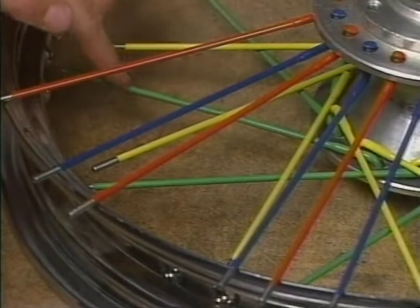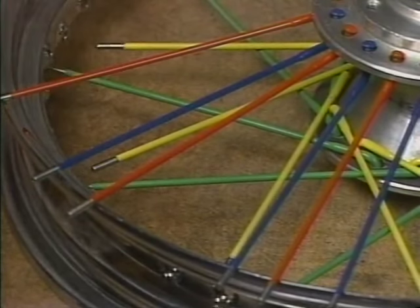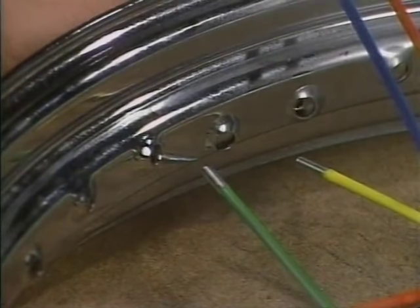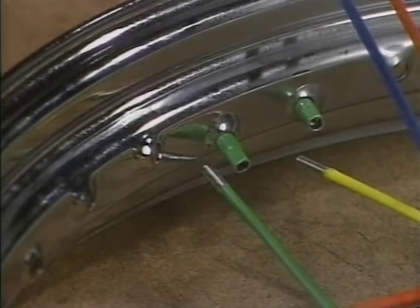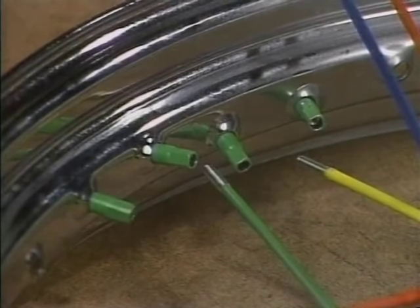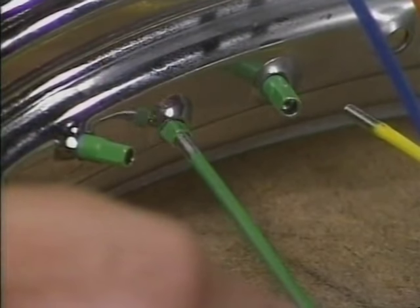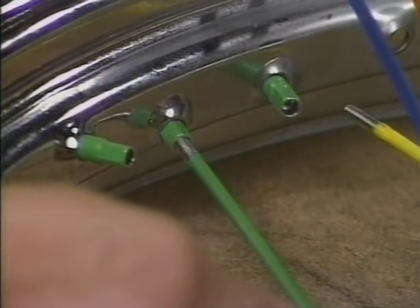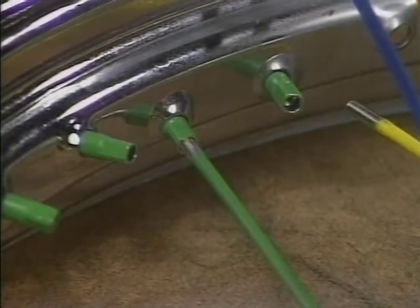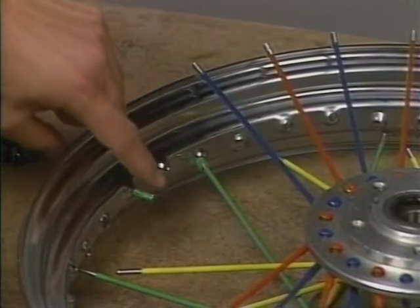Now, you are ready to lace the first row. On the bottom flange, work with the bottom row of outside short head spokes first. Choose a beginning spoke and four rim holes in the correct area. Use spoke nipples to accentuate the direction of the rim holes. Locate a hole pointing down and toward the bottom row of spokes. You will see that only one of the four holes is positioned correctly for an outside spoke on that flange. Make sure the spoke doesn't have to reach for the hole. Secure the spoke with a spoke nipple loosely by hand.